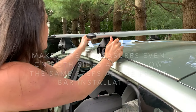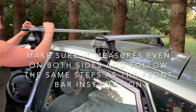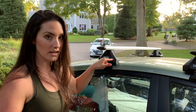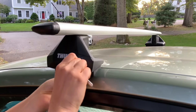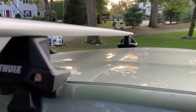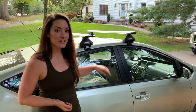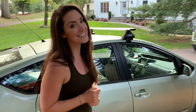I'm popping this down, making sure this is on correctly — I did have to move this to make that happen, so I'm just going to re-measure. From bar to bar we placed these in and measured them out. There's an option to plug these up with the black pieces they give you, or you can use your own special locks. Take the key, place it into your lock, find that perfect spot where it goes in, lock it, and it's in nice. Do that to all of them — find that perfect spot, lock it, and they're all on nice and tight. There you have it — that's how you install your Thule Evo Wing Bars on a bare roof. See you next time — don't forget to like, subscribe, and share with your friends!